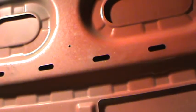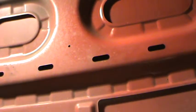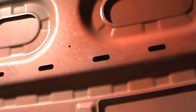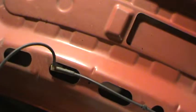Oh, sorry about that, guys. Swivels and extensions are gonna save you a lot on this job. You might get lucky. Since I'm over here on number 6, this is where I need a swivel, so give me 1 second. Swivel 7. I'm basically using a socket 7, but no, you need a swivel. So give me 1 second.